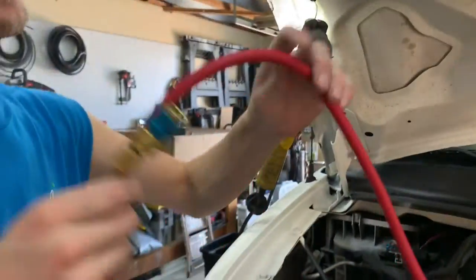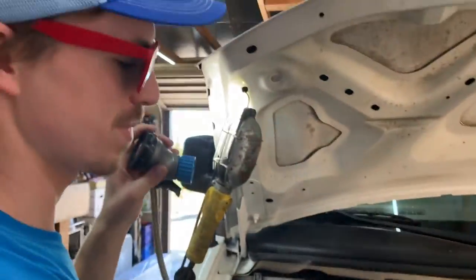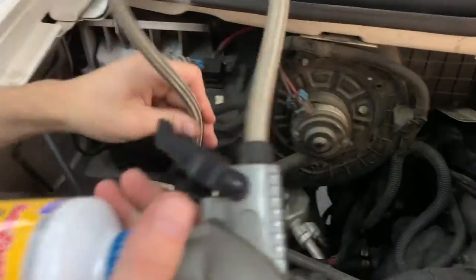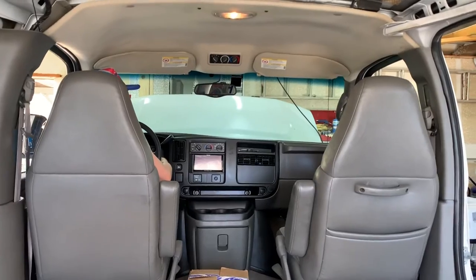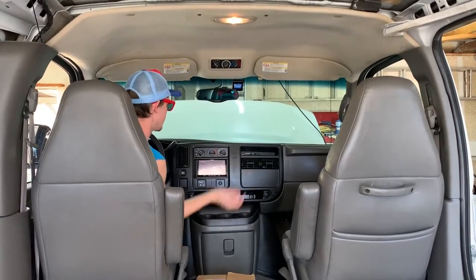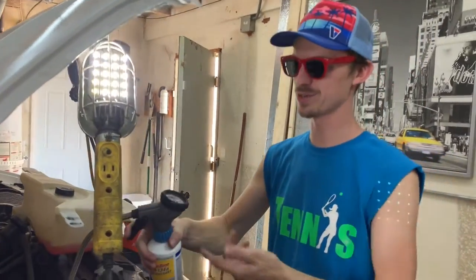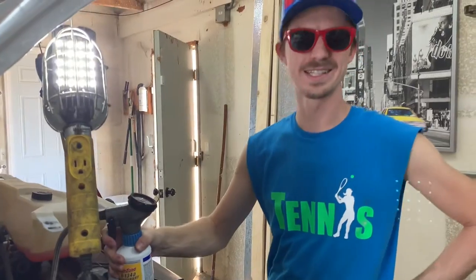I have these fancy manifold gauges but I don't actually have the adapter to use them, so you can laugh all you want. I do have this cheap adapter that goes onto these bottles. Connect the low side right here. If you have a stainless braided line like this, be careful — your positive post is right here and if you ground that out, there's going to be a fire and it'll start melting wires. Back should be blocked off now. Start it up, turn the AC on max and the fan on high. Let's jump back out to the outside and fill it up — it's really easy.